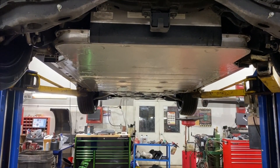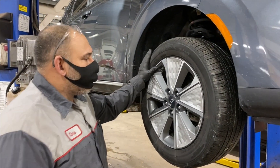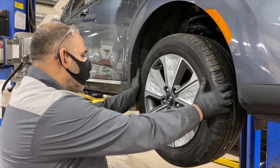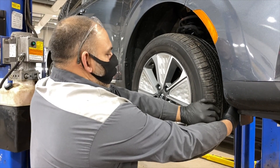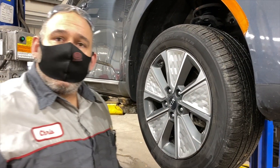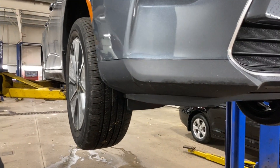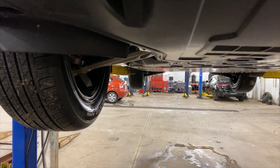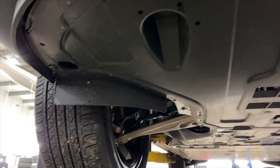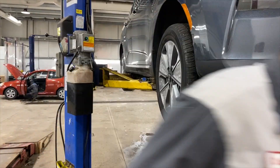Before we take the wheels off, Chris is going to inspect the steering and suspension. Chris, what are you doing here? We're inspecting the ball joints and tie rods to make sure they don't exhibit any excessive axial play. In this case everything's pretty tight, so everything's good. People forget that with a regular oil change on a gas car there are a number of inspections — we've even seen Sorentos with ball joints that needed early replacement, so these inspections are still important.